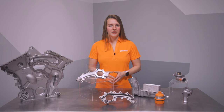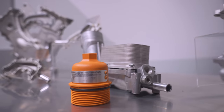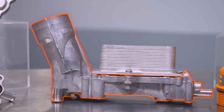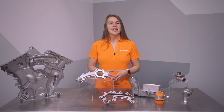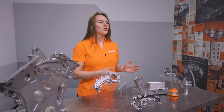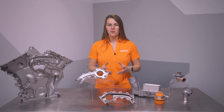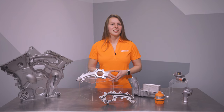So we suggest beefing up your Pentastar, and we make the parts to do that. These engines have a couple spots they can leak either oil or coolant. First up is the oil filter housing. The factory housing is a plastic unit, and regular old oil changes, heat, and chemicals take their toll on the unit. Sooner or later, they all warp or crack. Our aluminum replacements are the fix — stronger and more resistant to the oil and coolant flowing through them, they're the permanent repair to stop the constant oil leaks that can plague a Pentastar over the course of its service life.